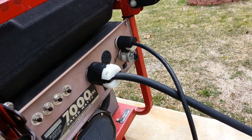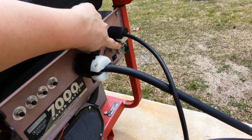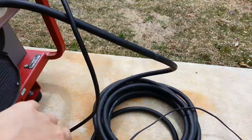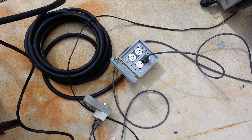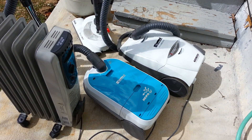I have the neutral floating for when I connect to a transfer switch, so what I did was make a jumper here — this is just bonding the neutral to ground so I don't get shocked. The 30-amp goes to a double duplex outlet, and I have here today two vacuum cleaners.